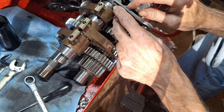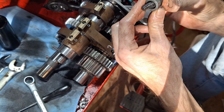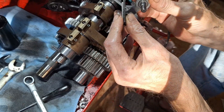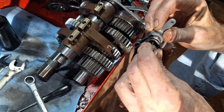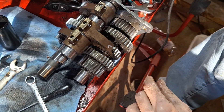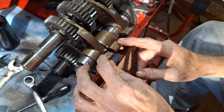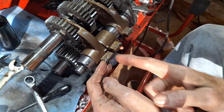There we go. If you look right here — that's your detent right there. It just rides directly on that stud right there. That little plate is what actually holds the shift drum in there. We're just going to slide it back together. And again, you want to replace that nylock right there. To get the shift drum out, you have to pull the cotter pins out — there are three cotter pins holding the shift works in there, and there's a little pin that slides in. You'll see it in a minute.